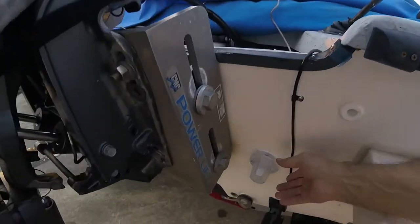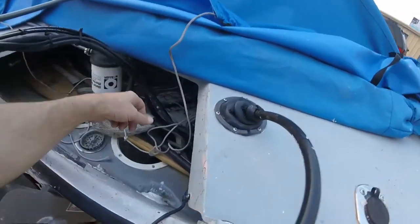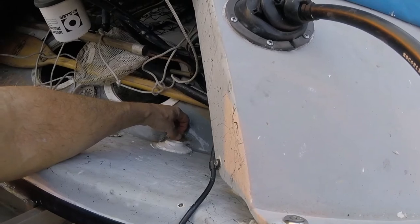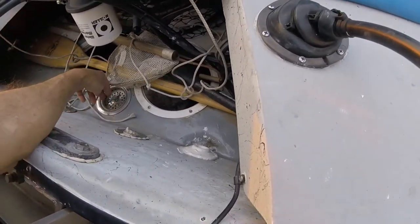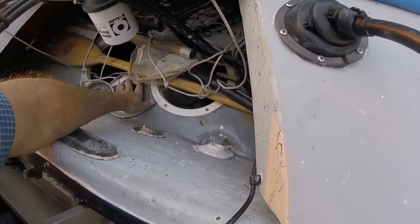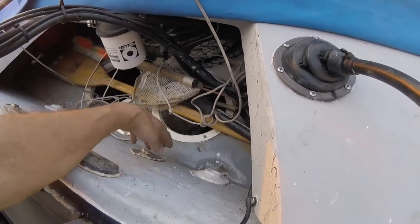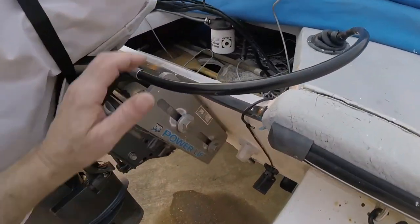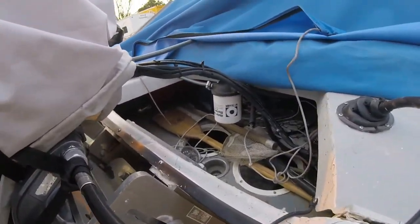The other one — looks like I screwed it on just a tiny bit sideways, but the boat's never level in the water anyway so it'll be fine. The only thing I noticed is that because I used a smaller hole it's a little higher, so I'll get a little more water in it before it starts running out. That's probably what the previous owner put that sink drain in there for — real ghetto but the thing works. I'll stick a regular deck plate on there and seal the wood. Looks like we're good to go. Hackberry is on the agenda in a couple of weeks — I might take it out tomorrow. Until next time, this is Blues Guitar 49, adios.